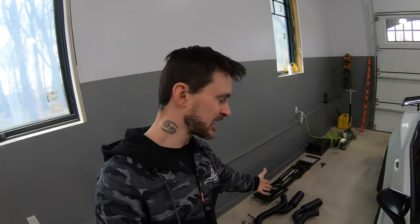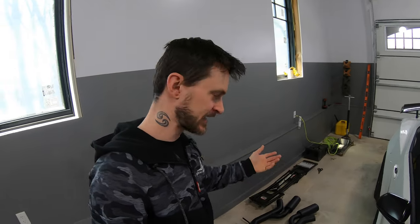So it's basically like adding horsepower, but not really. It's just you're not losing horsepower, because that's going to fill in some gaps where there may be one. That's going to completely also change the sound too. So another bonus of a Helmholtz is you really cut down on any nasty raspiness in an exhaust, because you don't have that chance for that rasp to occur, because you're basically adding some extra exhaust in as it gets stored and bottled up inside of that bottle resonator, which technically isn't a bottle resonator, it's a Helmholtz.